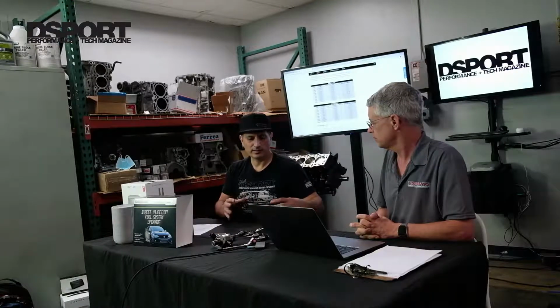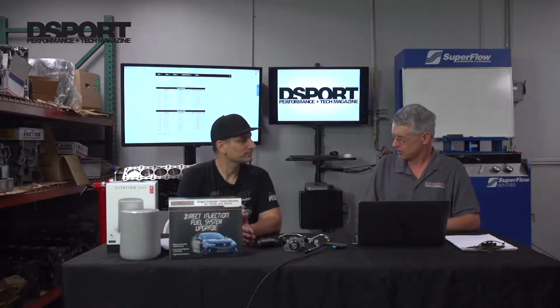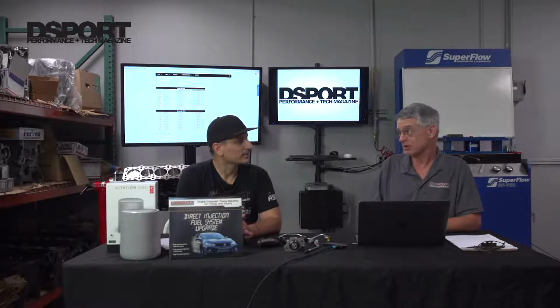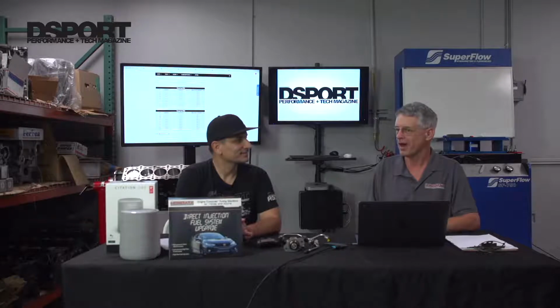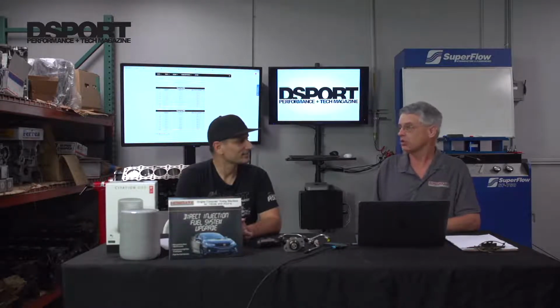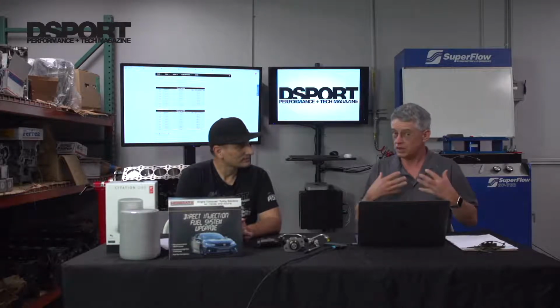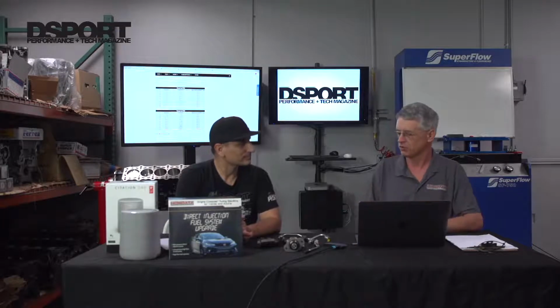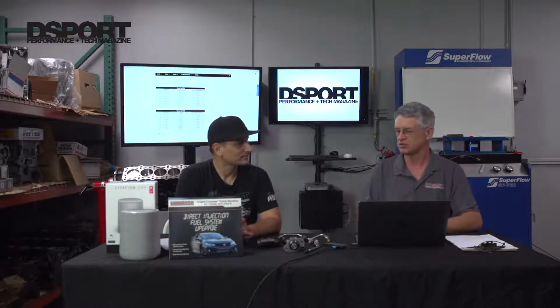Is there a way to integrate the port fuel injection on top of this, or is this kind of separate? Port fuel injection is separate, but you're asking, what if you want to make 550 horsepower? Okay, yes. That's exactly what we were doing just a couple of days ago. So it's R&D, we're still working on it, and this is the future of some of the products we're working on, how you can make more power above 500 horsepower without having to go to the complexity of port fuel injection, which requires separate fueling systems, separate management for it. It's not simple, so we try and keep things simple, and we're trying to do it with stock components in the vehicle or just slight modifications without any significant changes to plumbing.